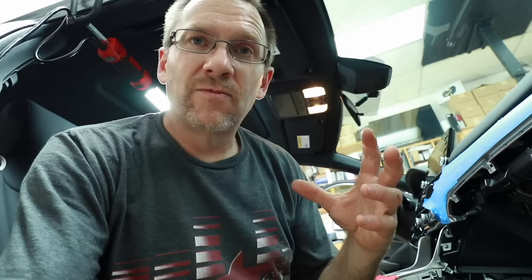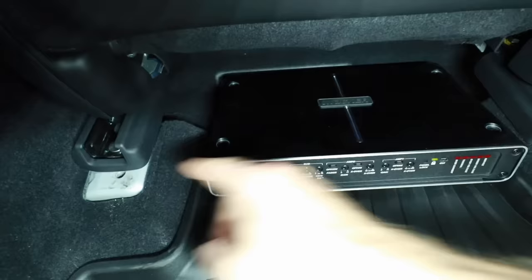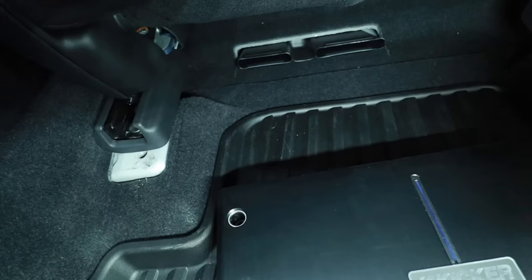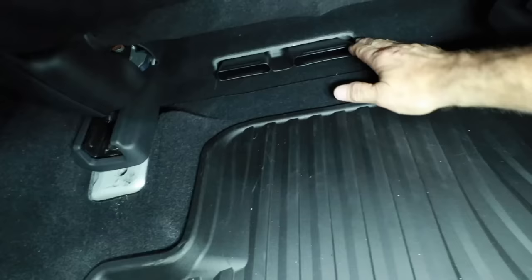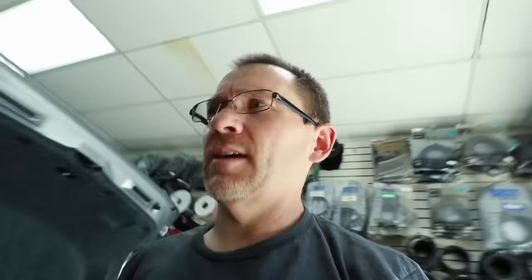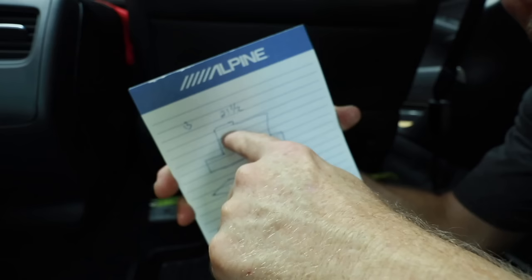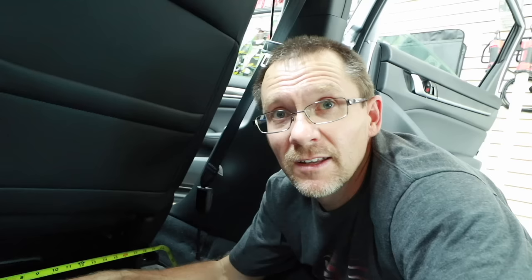Now we have a clear path for how we're going to get signal out of the radio. What we need to do next is figure out how we're going to mount the amplifier underneath this seat. This is the amplifier — there's a nice shelf here. We want to bring it up high off the floor so the floor mat still goes back in and the vent will still blow forward. We're going to make a T-shape that goes across between the two seat risers, then goes forward and tongues into the vent area, using that as the lock for the front mount. We'll make it out of quarter-inch ABS — strong and rigid. The basic shape will include a dip down and back up where the vent is. We might also add a front panel to cover where the controls are on the amplifier.